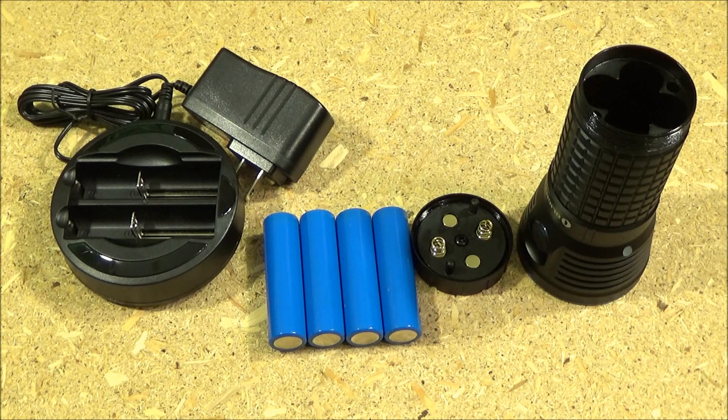To get to that 9,000 lumen turbo mode, your batteries have to be capable of doing at least eight amps. Typical batteries of this type, even good ones, are often only five or six amps. So they had to make basically special batteries for this light — they buy them and brand them. Instead of normal Olight batteries, you have to use ones with the HDC marking: high discharge batteries. My review units are unmarked, but production ones have to have that marking.